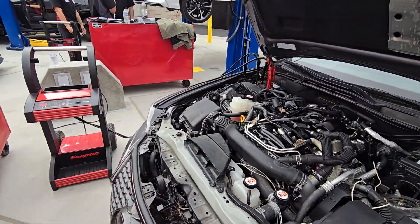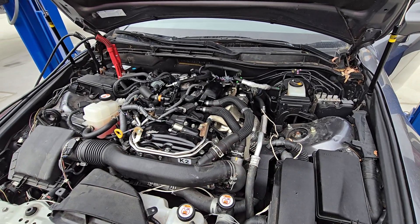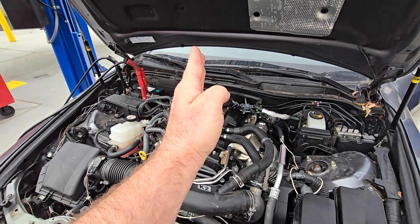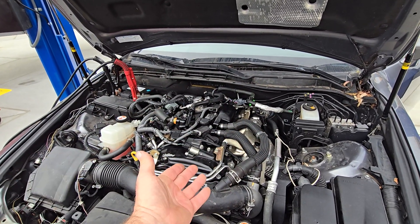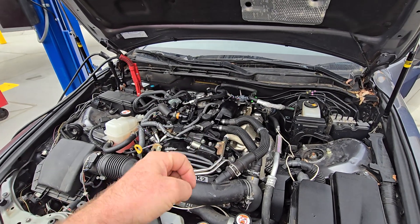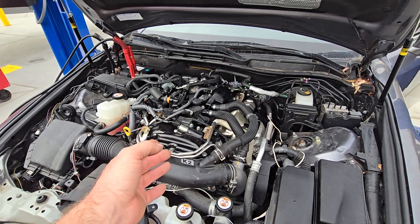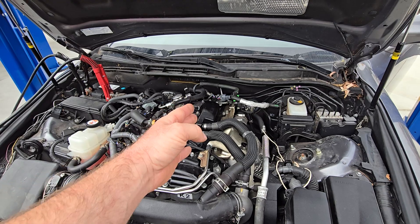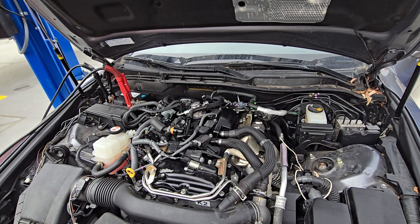All right, so this is the purpose of the test. When it's running the starter, it's watching the crankshaft speed. It knows when the crankshaft is in — let's just say — from 12 o'clock to the first 6 o'clock, that first 180 degrees. Maybe cylinder one is coming up on compression, the crankshaft is going to have a speed, and it was about 170 RPM. Then — this is not the firing order, but let's just fib — on the next 180, let's say it's cylinder number two, that actually sped up to 235.